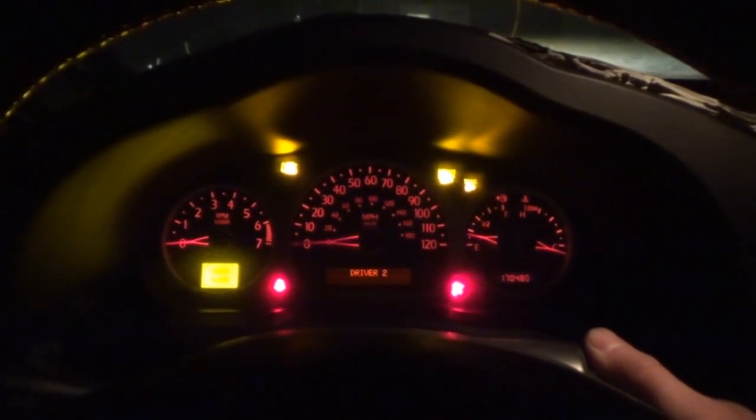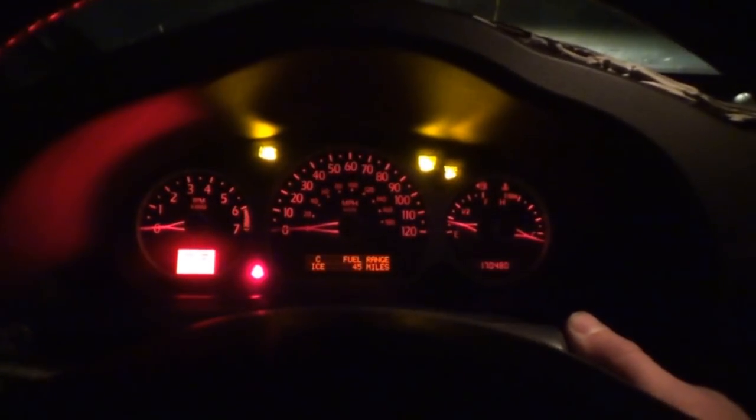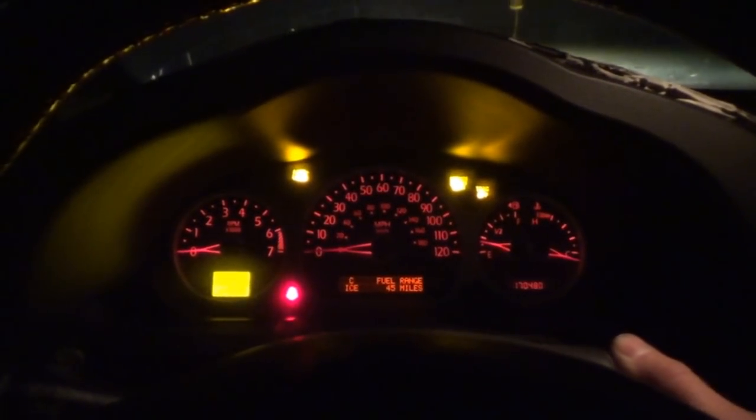It's actually, I hate that compressor. I'll wait for that to go off. It'll probably be a minute. I'm gonna have to find the fuse for that and unplug it. It's no good right now anyway, it's not even hooked up. The rear air suspension probably doesn't even work. The shocks are probably old and leaky, and I want to convert it over to just the standard non-air rod shocks. Okay, here we go.